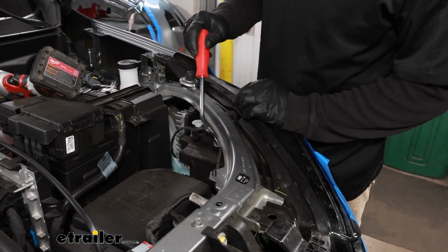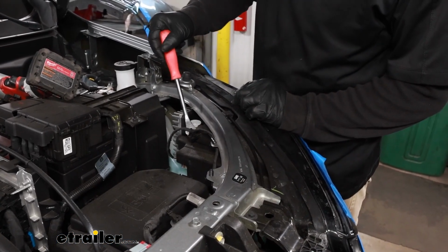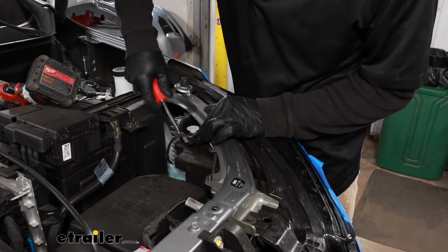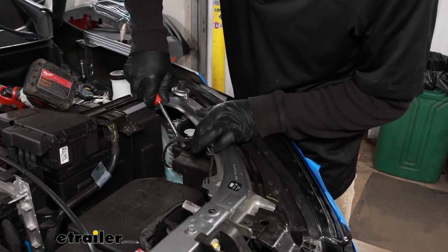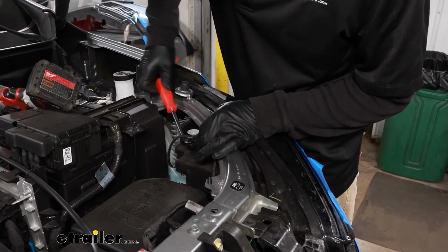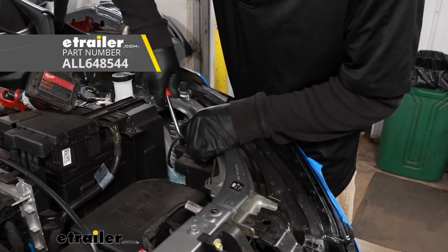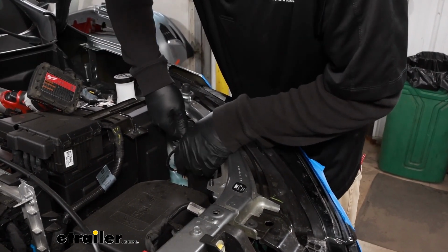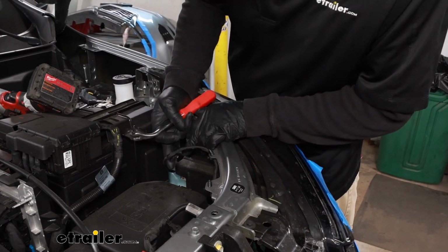If you go to your headlights now, there's going to be a wire that comes. It has a push pin fastener holding the wiring up, and we're going to remove that now. It's just easier because the headlights are going to need to come out. So just a trim tool, and you can pop that right out.